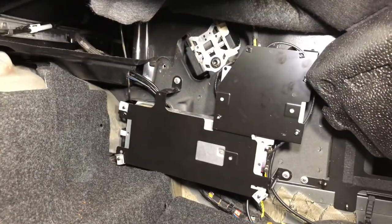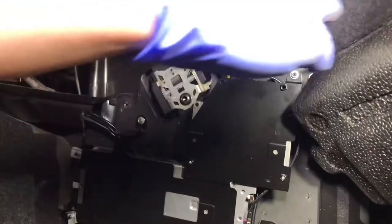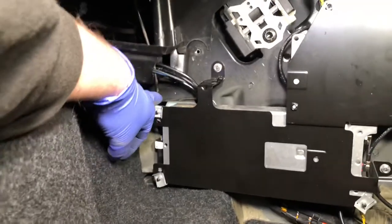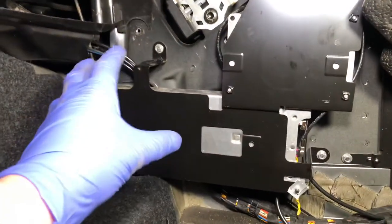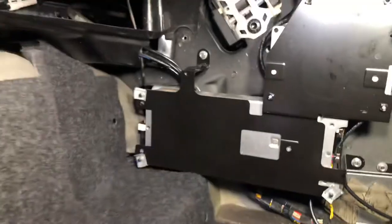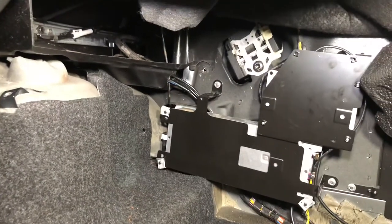If this turns out to be a workable location we'll test it now; if not we'll move it to another location on the left hand side. We did have it before on top of the ULF and the audio diplexer but it was just pushing the top carpet a little bit high, which would have meant trimming the top tray — we didn't really want to do that. So we've removed the ULF module, just unbolted it off the bulkhead, and that's allowed us to get the motor — you can just see a little bit of the white reservoir through the bulkhead. It's now sat nicely on a bit of the wiring loom. It's a very lightweight, non-sharp component and the hydraulic fluid and electric cables are cable tied to the bracket just there. It's surprisingly steady, almost wedged in, not touching the bulkhead, doesn't feel it can move or bounce about. The carpet system and tray go back in perfectly — you don't see anything bulky pushing the carpet out.